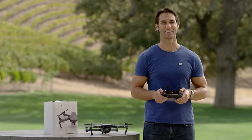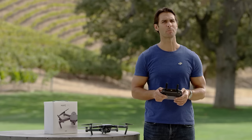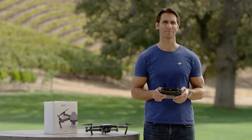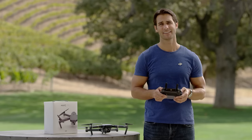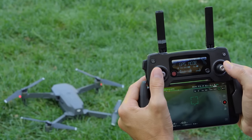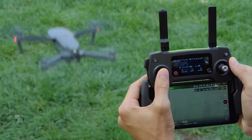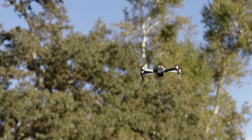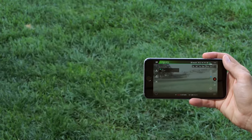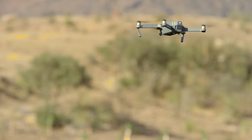We're ready for takeoff. Launching your Mavic into the sky couldn't be easier. First, check the propellers for any scratches or damage, as these may unbalance your Mavic, making it less easy to fly. Next, switch the propellers on by holding the control sticks down and toward the middle — the rotors will start to spin. Push the left stick up to start to ascend, or use the DJI GO app to take off by swiping your finger. Once the Mavic is at a comfortable height, release the left stick and it will hover in place.